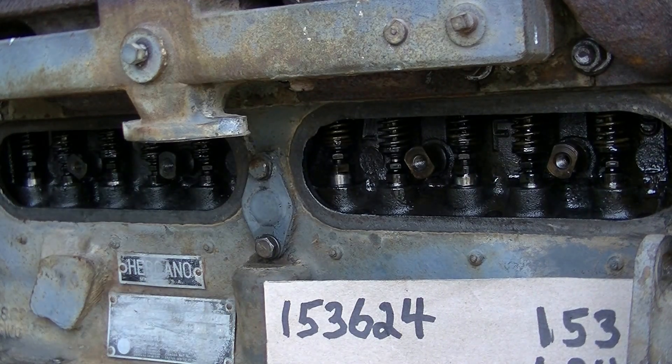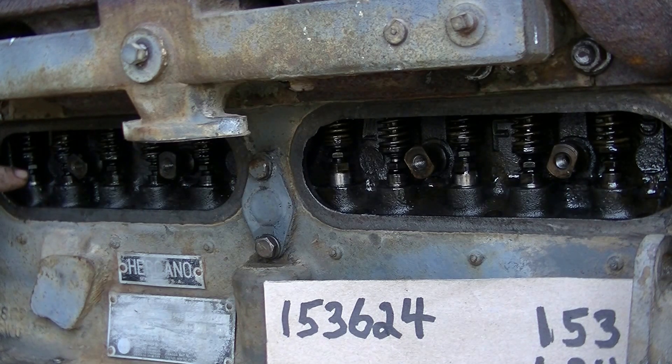I've got the starter off and I'm just using this pry bar to slowly rotate the engine. As you can see, this lifter is going down on number six cylinder. Very soon it will reach near the bottom and the intake will start to open — it's on the end of its exhaust stroke, ready to pull in another charge of fresh air and fuel.